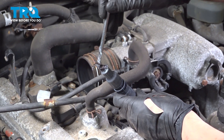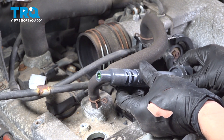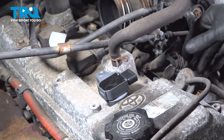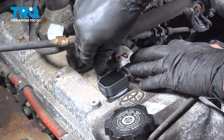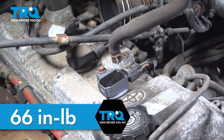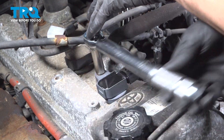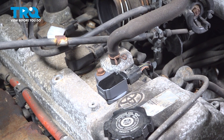I like to put just a little bit of dielectric grease on the inside of the boot here, just on the side. You don't want to stuff it full — you don't want to put a lot in, otherwise it will break the connection between the spark plug and the ignition coil. Now that you have it coated, go ahead and drop it down into the cylinder all the way. Plug it in and make sure that clicks. Put the bolt back on, start it by hand, bottom it out. The torque for this, if you're able to torque it, is 66 inch pounds — it is very low. If you are not able to torque it that low, just snug it up and give it about an eighth of a turn after it bottoms out. That was pretty much spot on an eighth of a turn after it got snug.